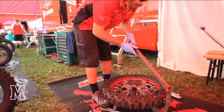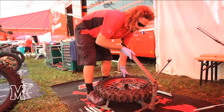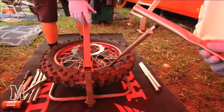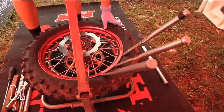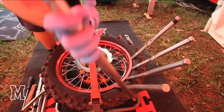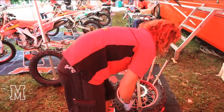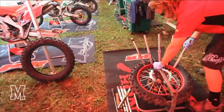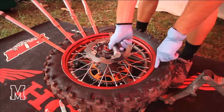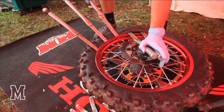To start, we use this lever of the tire removal tool to fold the tire. Like this. Under the edge of the rim, with a distance of about 10 cm between levers. Then we turn the tire to fold it down. You start with the first lever, so the tire goes down into the circle channel, which makes it easier to mount.